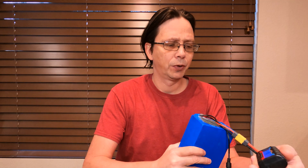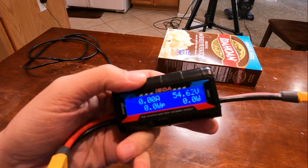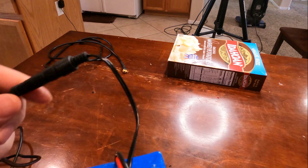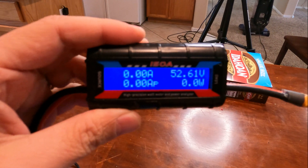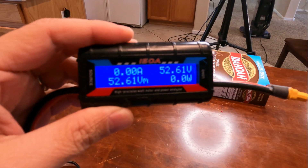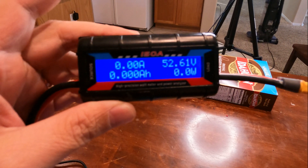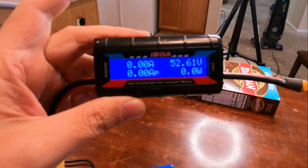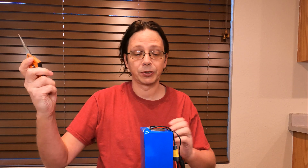Hey, how's it going? I'm gonna try to figure out what's going on with my bike battery and show you what's happening. Right now it says 54.6636 volts, which is great. But if I unplug the charger it's 52.61 volts. So I lost a couple of volts there — something is definitely going on, the battery's not at full charge or the BMS isn't outputting full charge. I'm gonna cut into the battery and diagnose the BMS to see if I can fix this.